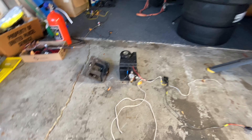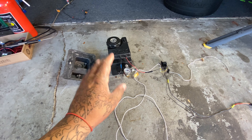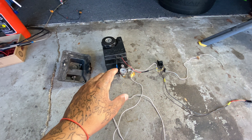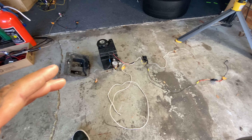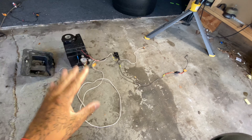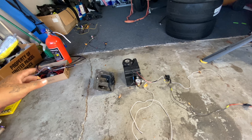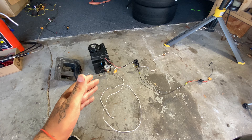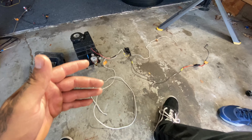Hey, look who's here — Wayne Hall! It's hot out here in Cali. All right guys, I'm going to go over my Nitrous Express safe system — the standalone fuel enrichment system. The acronym is SAFE. If you saw my video from the last couple days explaining the wiring harness and my purge, it's essentially the same thing but two different types. The purge clears the lines; this system gets the fuel pump going so when you shoot nitrous it shoots in with it, straight into the plate.